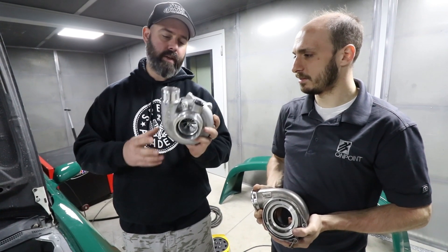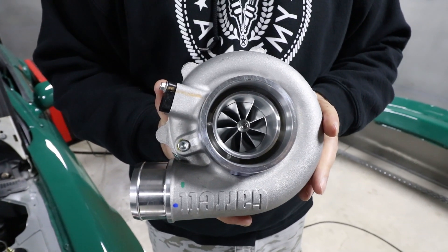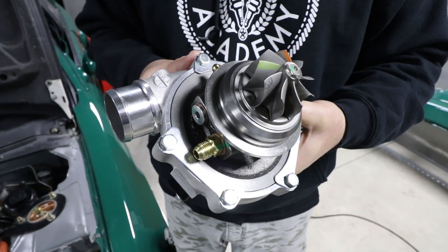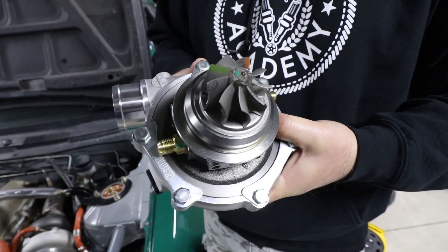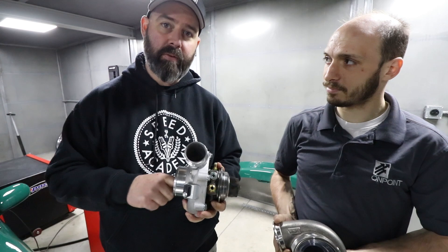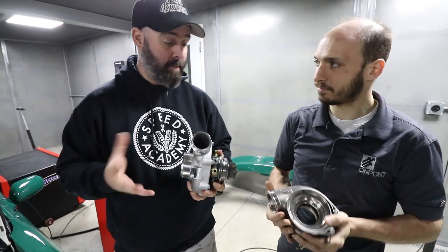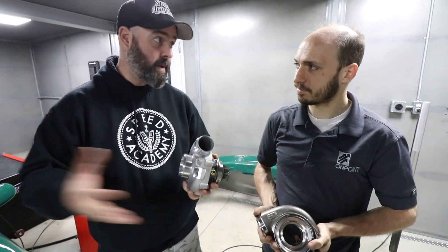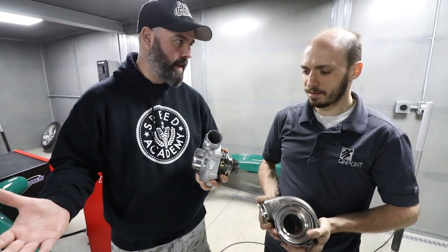They're going to the new G series — specifically the G25 550. The 550 indicates the max horsepower rating; there's also a 660 version. This is a clean sheet design turbo where all the magic happens with redesigned compressor and turbine wheels, making it more efficient by around 15 to 20% compared to GTX wheels. The question is how much response time is gained and what the trade-off is in peak power and area under the curve.